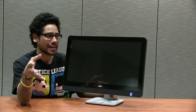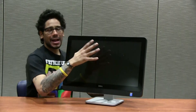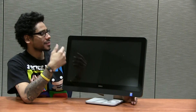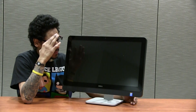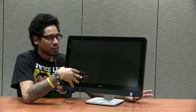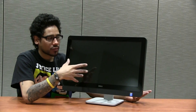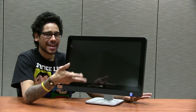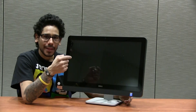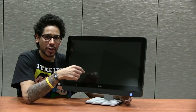One thing I don't like about the all-in-ones — the i7 we purchased wasn't touch screen, but this i5 is touch screen. That means the drivers are a little different. I have to wipe it clean and re-image it, because we're not really a Windows 8 shop yet. No one really likes Windows 8, so I have to put Windows 7 on it.